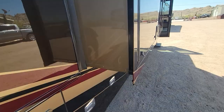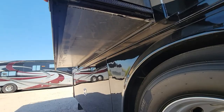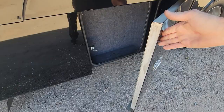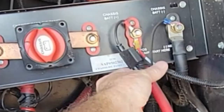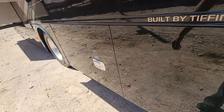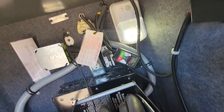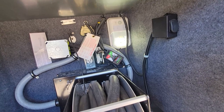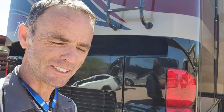Although this is not the seamless fiberglass slide-out boxes you'll see on a modern Tiffin, these are very durable slide-out boxes made in 2014 - even aluminum down there. Another thing Tiffin does that I've always enjoyed: besides having a battery disconnect right here for the chassis batteries, there's a battery maintainer for the chassis battery. Instead of having a complicated relay system and a smart charger, it just has a plug-in battery maintainer that plugs into a 110 outlet right there. Whenever you're plugged into 110 or running the generator, it will start charging and maintaining the chassis battery. No complicated electronics, and that's easy to change out. Tiffin thought of this back around 2006. Very, very simple - keep it simple.